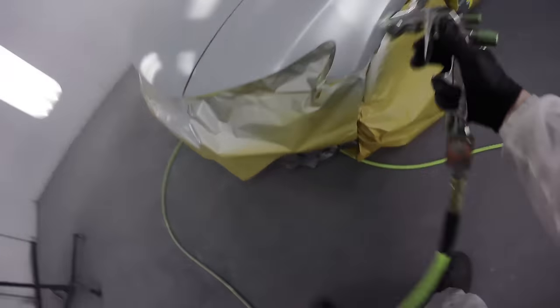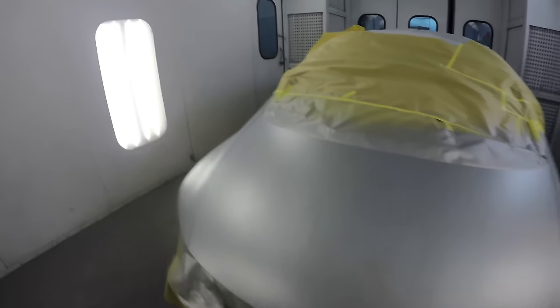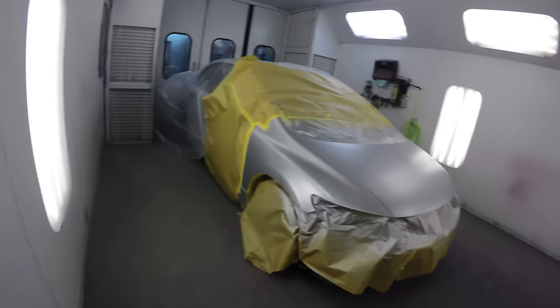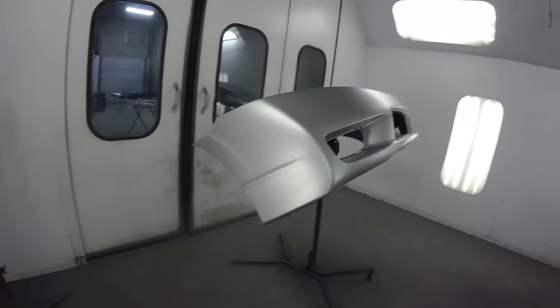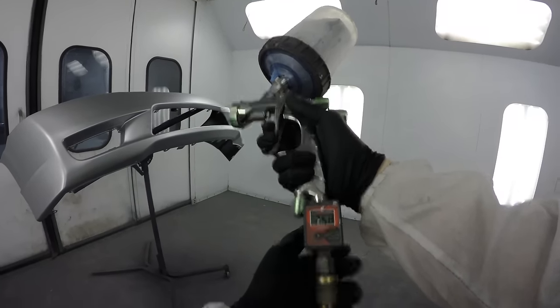Let's talk about the prep work. When a bumper comes in, it comes with either a poor primer, a good primer, or raw plastic. Honda is one of the rare ones that gives you a good primer on their bumpers. Sometimes you get a really weak primer that wouldn't hold up, so you end up having to wipe it off and start with plastic. In this case we had a good primer, so we sanded it down with 500-600 grit paper, finishing with 600. For the hood, they stripped it, primed it, made repairs, sanded it down, and finished the blend areas with 1500 grit, a gray nylon pad, and some sanding paste.